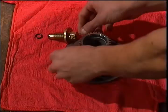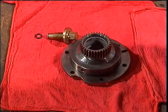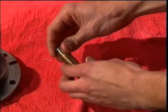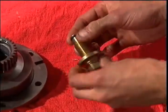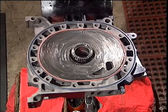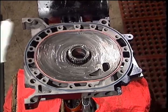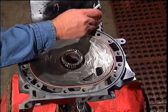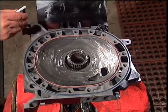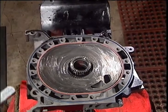Prep your rear gear by installing a new O-ring, which is included in the overhaul kit. Apply petroleum jelly on the bearing surface and a new O-ring on the front main bolt. Finally, we are in the last stages of assembly. Apply RTV black to the oil galley area and the legs on the lower portion of the end plate. Another Atkins helpful hint: if you don't apply sealant to these legs, oil will seep or wick between the metal-to-metal finishes of the end plates and rotor housings.